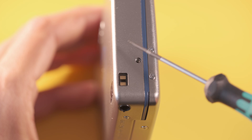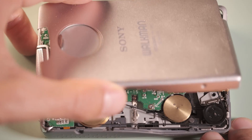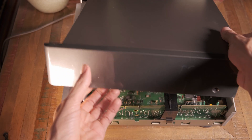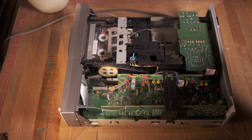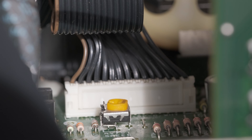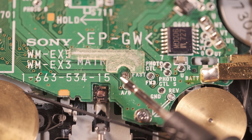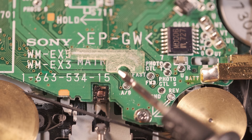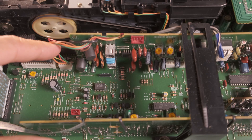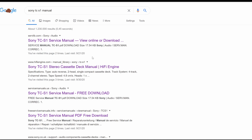Some decks or Walkmans have an outboard adjustment mechanism, which makes the whole process incredibly easy, but in the vast majority of cases we will need to dismantle our machines. Removing the cover and finding the speed calibration screw might be uncomplicated sometimes, but on high-end cassette decks things might get difficult. The screw is usually on the motor itself or very close to it on the circuit board. On many Walkmans you will find a tiny screw on the main board with a little arrow pointing in the direction you have to turn in order to gain speed. You can give it a try and see if you find it without any assistance, or you can spend one minute on the internet and find the right service manual, which will make things simpler and safer.